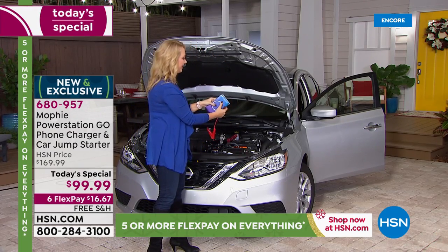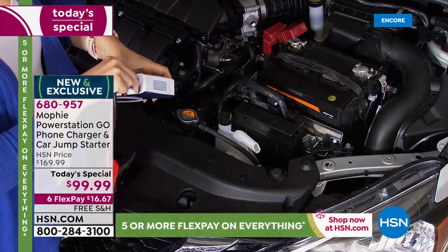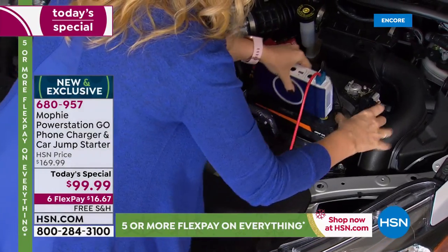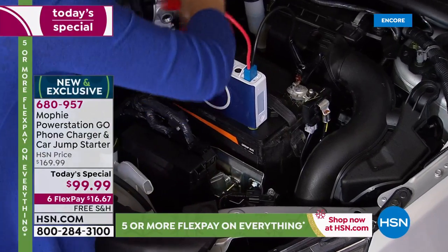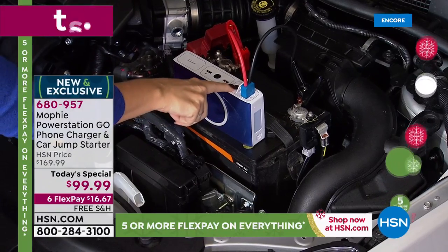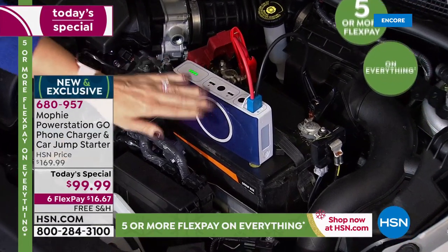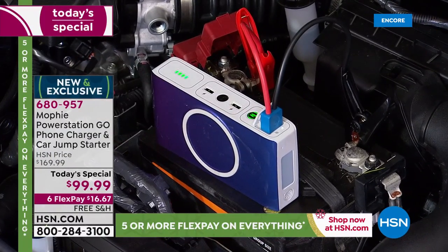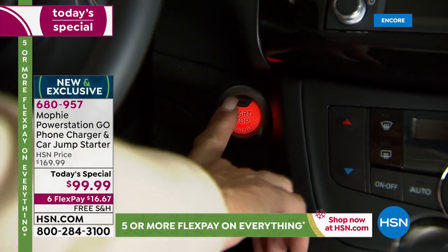Really easy, guys. You're getting these jumper cables, and they only go in one way. So all you do is you just pop them right in, just like this, okay? Then you're going to take and attach, and it goes anywhere on this battery. So I'm going to do black to black right here. I'm going to do red to red right here. And in a couple seconds, all I'm going to do is press this button right here. Green blinking means thinking. So this is processing through the safety checks. Now, guess what? Solid green light. That means go. Suzanne, go ahead and power the vehicle. Ready? Yeah, and all my stuff's lit up in here saying go ahead.